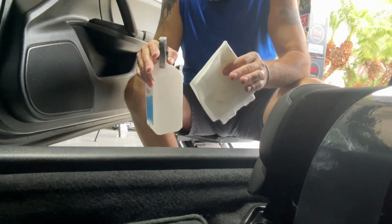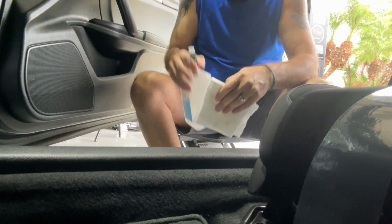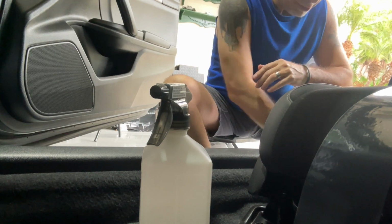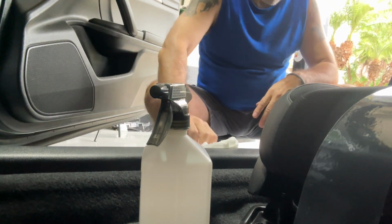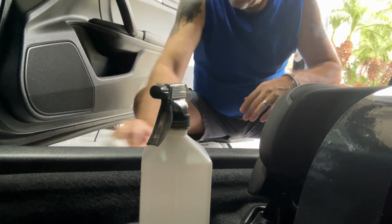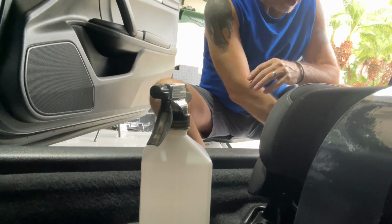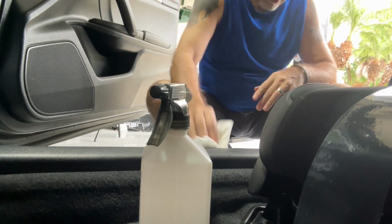Almost forgot to clean it off with the rubbing alcohol myself. It's a very important step. Again, you want the best opportunity for adhesion, obviously. So you don't want a bunch of dirt and junk on here. And make sure you get around the lip of this thing, because it is going to go over the edge a little bit. I'll show you when we're done. But again, very important to get this clean, even underneath the seal here. Right down here in the front, if you're going to tuck it under a little bit.